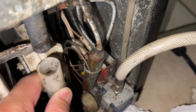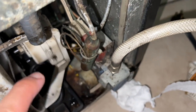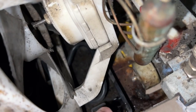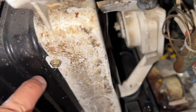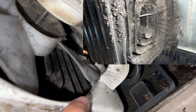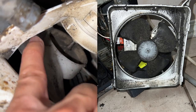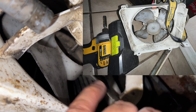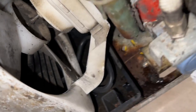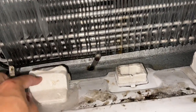The drain port is draining good. I took this off to gain access — you can use a shop vac if you're doing a flush out. In this case I was able to just take this out and put a cup underneath. The condensate usually drips down over here. Another problem you could have is if you need to vacuum out inside the coils back here — before I vacuumed it, it was filled with dust and the fan had a lot of stuff on it too. Make sure the fan is working clear and vacuum out your coils.